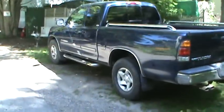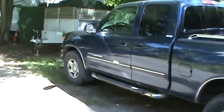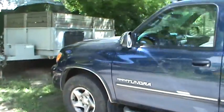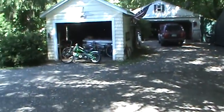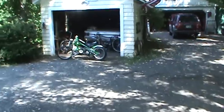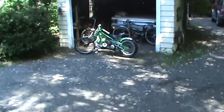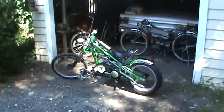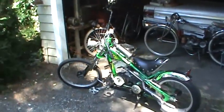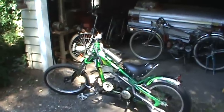Finally got my truck inspected. It kept failing for a cat. It's in cat efficiency. Changing oxygen sensors, and one of the oxygen sensors came back circuit malfunction, and I ended up taking the original oxygen sensor and cleaning it with brake cleaner and put it back in, and so far so good. It went long enough to get a code. Played with the bikes a little bit.